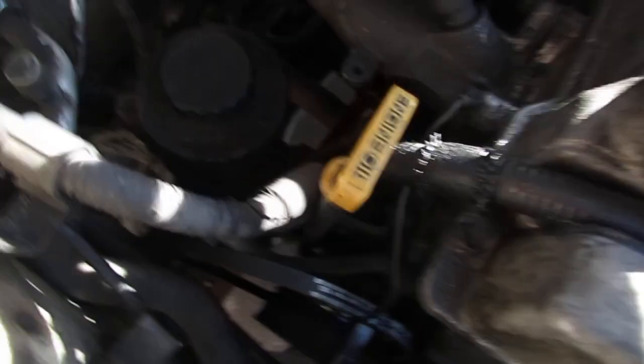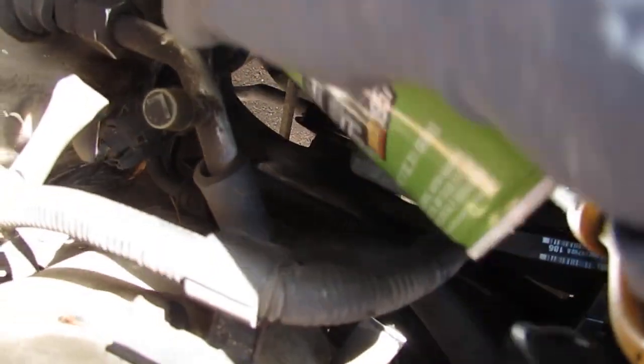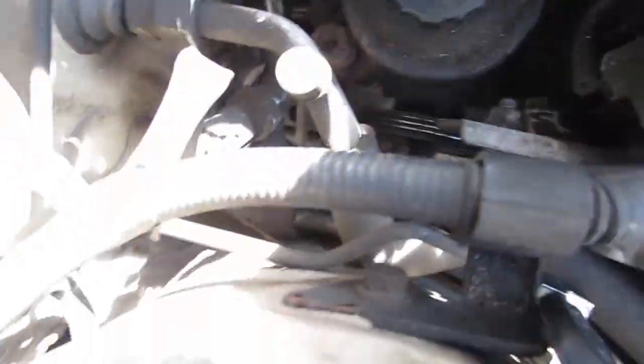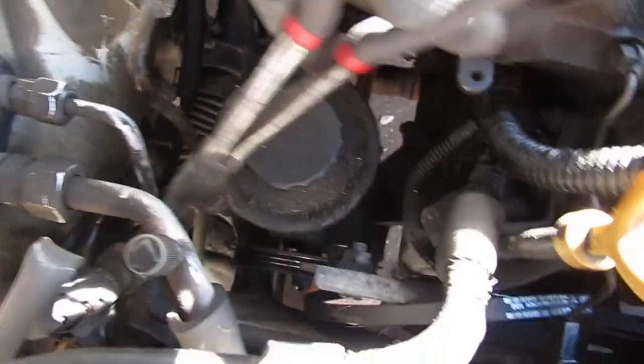Okay. So what I like to do, right? I like to take a little bit of silicone spray. Not a sponsor. Right, and spray right around the clamp like that, so that way I can turn it. It's a little easier to turn, so I'm using this to try to reach down in there and turn it.